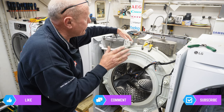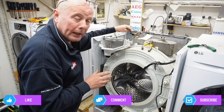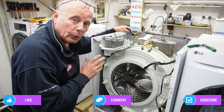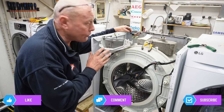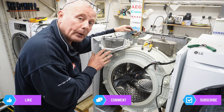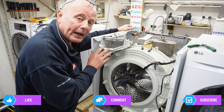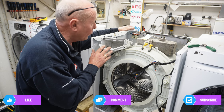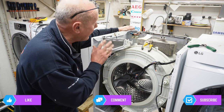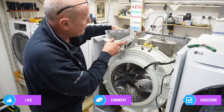The program sends power to one of the water valves or to both of the water valves. If your machine is not filling with water, you may have a problem with the solenoids on top of the water valves being burnt out. You may also have a problem with the filter at the back of the water valve. These can clog up with dirt over a period of time, and I'll show you that later in the video.